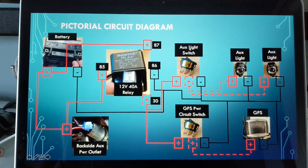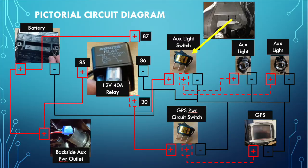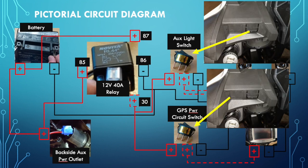I've done two switches — one for my aux lights and one for the GPS power. I'm putting these on the left side where there are two blank-offs. The reason I wanted to power my GPS on and off is that when I'm in town I don't need the GPS turning on and off all the time, so I want a hard power switch. Before, I used to have to pull the fuse on my V-Strom.